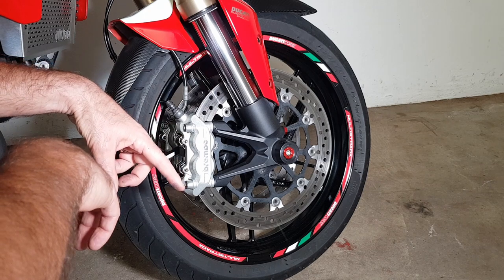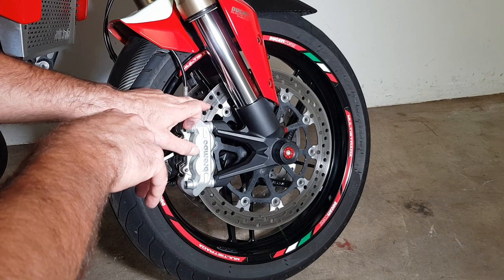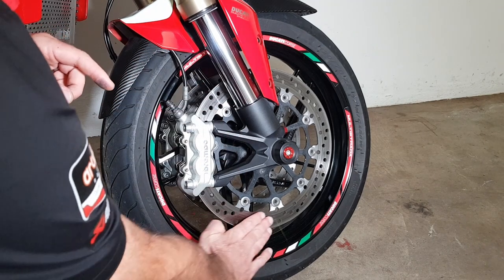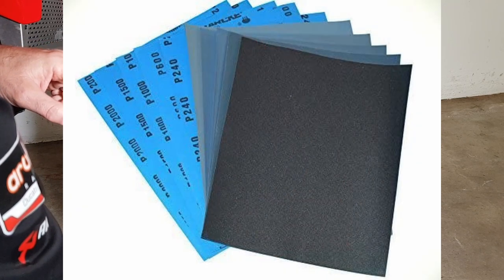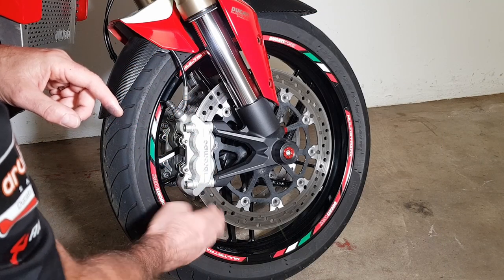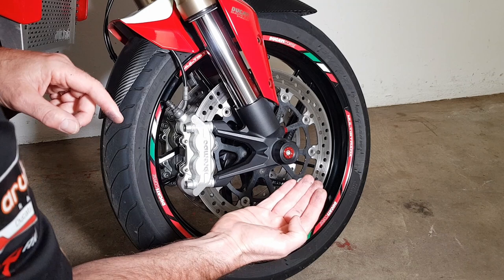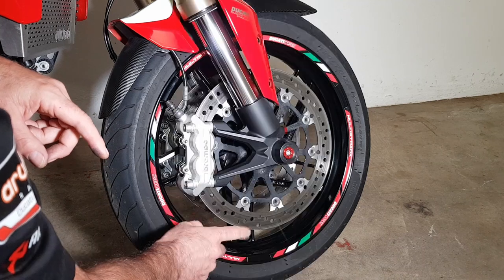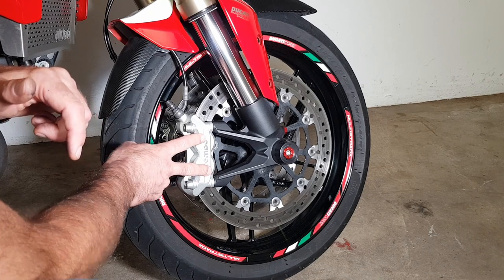Removing and taking off the pads is easy, and you're going to need to clean everything in warm soapy water. To complete the cleaning process you'll need three things. First: aluminium oxide sanding paper — ideally two types: 500 grit for cleaning the brake pads, and 1500 grit for cleaning the brake discs. The discs end up with old brake material bonded to them, and you need to sand that down with a very gentle circular motion. Second: brake cleaner — probably a couple of tins of sprayable brake cleaner.